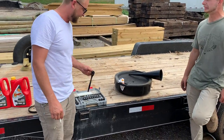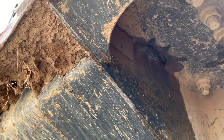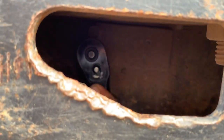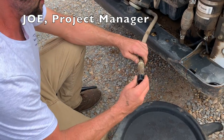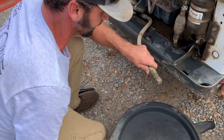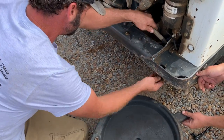To get started, you're going to need a 9/16 socket for the access plate right here at the bottom. We're going to remove it using our 9/16 wrench to run a drain tube from the bottom of the block to completely drain the motor oil. The drain tube has got a 7/8 cap, and you're going to want a vice grip or channel lock — something like that to grip it — and you'll run the tube through the opening.